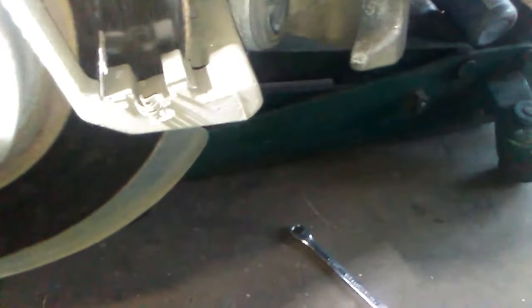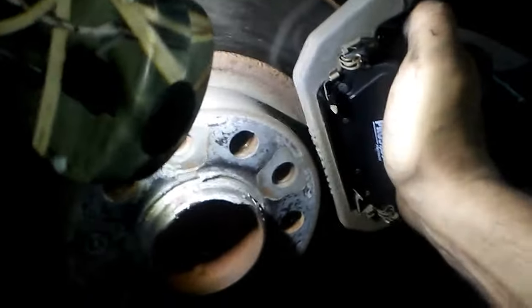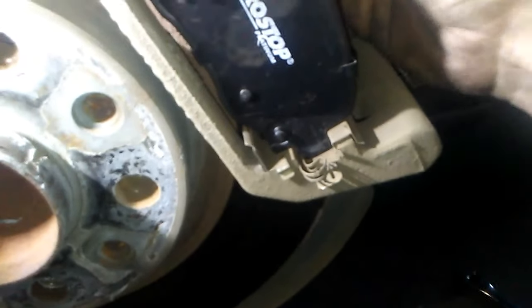Once that's all the way down to about right where I got it now, that's about good. Then just like the other brakes you slot the old ones out with the holders and slot the new ones in. There's still some life on these old ones. The new pad fits in there — if it fits in at an angle real tight there's a good chance you got rust behind the hardware. I'm gonna take this back off and grease all these ends. Slide this back in, close it right back down — that's the new brakes on.